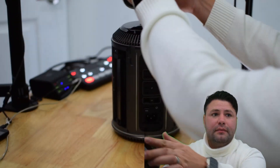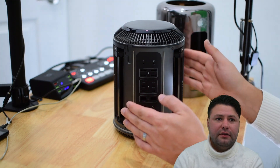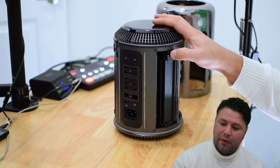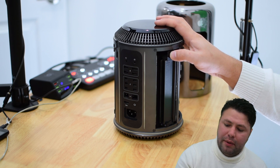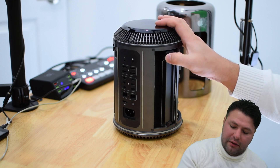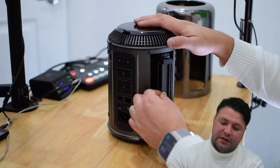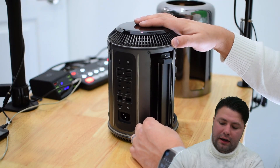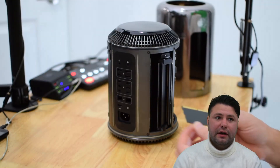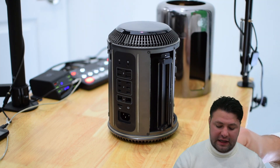Directly to the left and right are the memory banks. They're clipped in with a little button — if you just press it, push it up and inside at the same time, the memory module bank will come out and loosen a little bit. Once it pops out, grab the memory from the top or bottom and pull a little bit from one end, then a little bit from the other end, and it comes right out. Be very gentle and take out both modules.